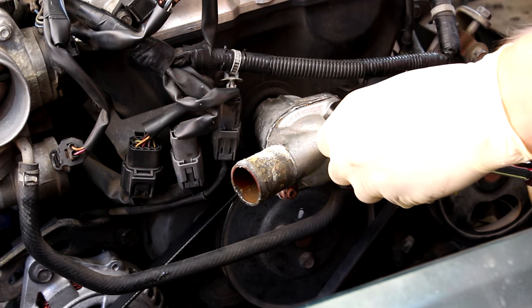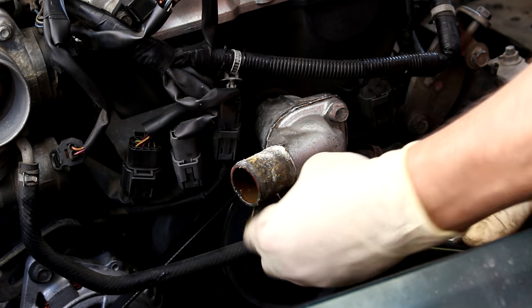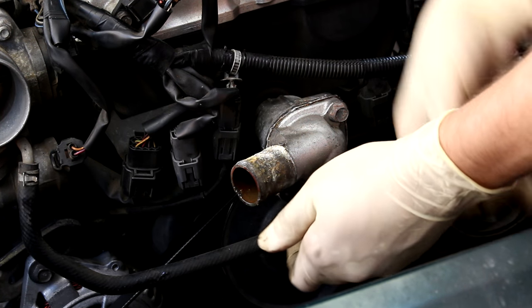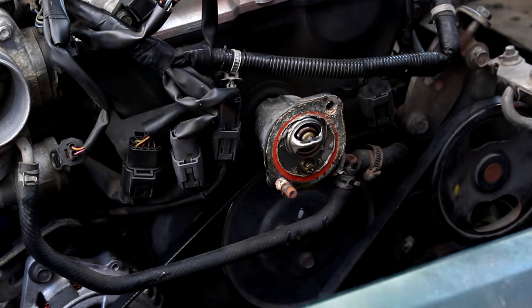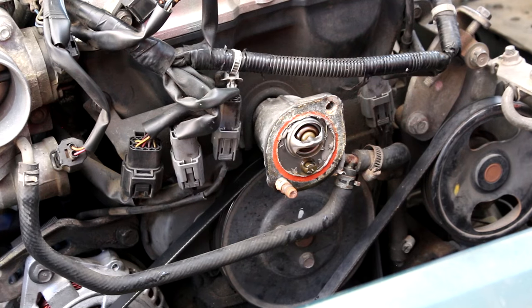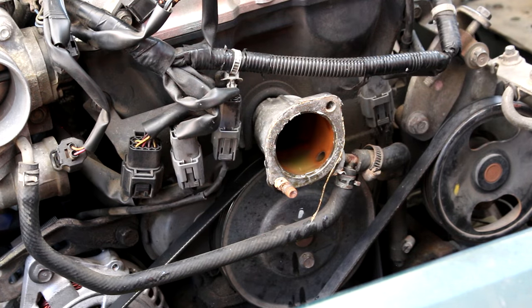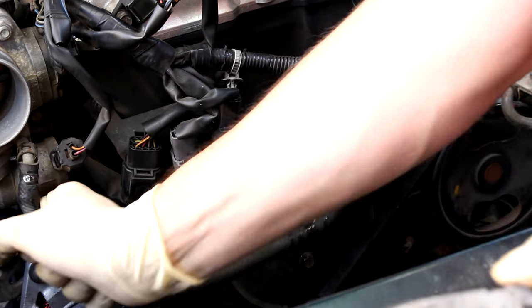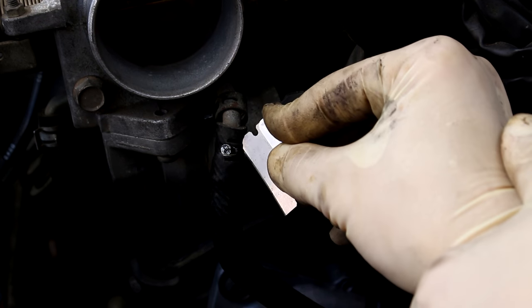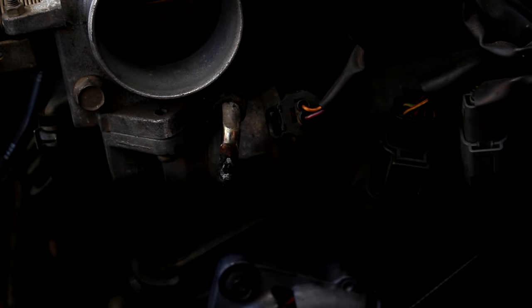As much as you think you're going to remember how everything goes back together, you're probably going to forget some things if this is your first time, so that's always a good idea. As much as I'd like to say this video will contain all the information needed for any beginner, it's really best to have a factory service manual or a Haynes manual by your side just in case. I'm opening up the thermostat housing here and pulling out this very stuck thermostat, removing some of these tiny cooling hoses. These things might be super seized onto your engine, so no worries if you can't pull them off — just cut them off with a razor blade because you are going to be replacing them.